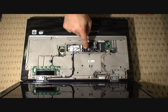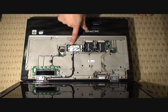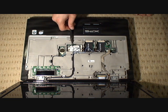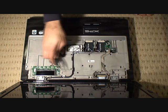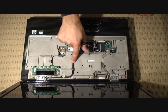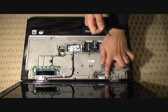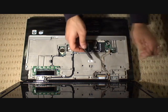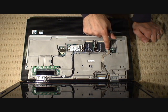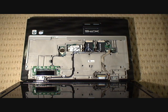As you can see, we've got everything back into their holding bays, the black and white cables connected to the wireless card, and this cable securely back into its trail path there. Make sure it's pushed right down, and we've got the GPU connection there and the webcam connection there, so they're all back into their locations.